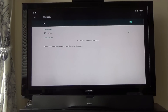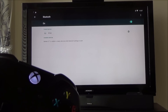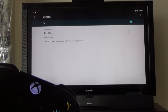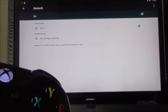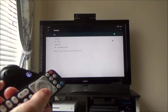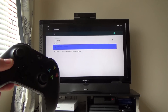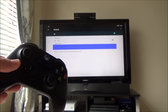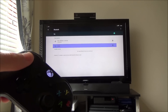It's still saying no nearby Bluetooth devices were found, so I'm just going to turn Bluetooth on and off again — or you can just refresh the page. For me it's just easier to turn it on and off. Let's turn it off and then back on again. And now this time, because this is still flashing, it should pick it up. There we go — can you see now it's come up with Xbox Wireless Controller. So we're going to move down to where it says Xbox Wireless Controller and just press OK. And now it says Pairing. And now in a little while it should connect. There we go — it is now connected and we can actually use our Xbox controller to move things on screen.